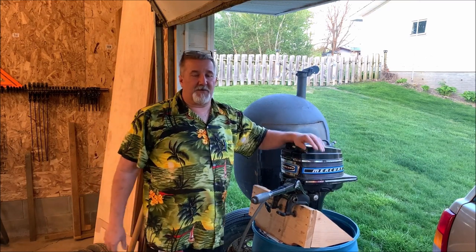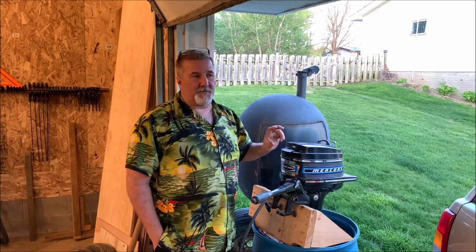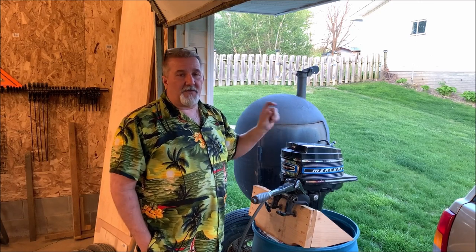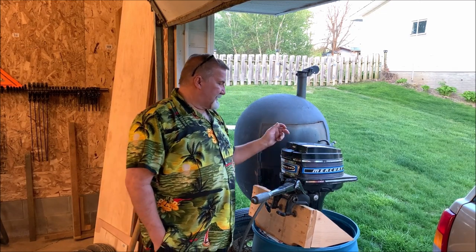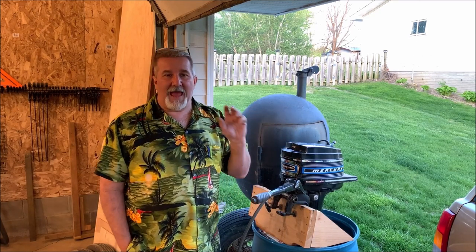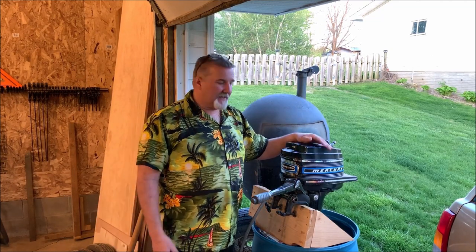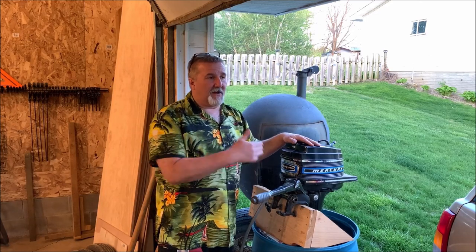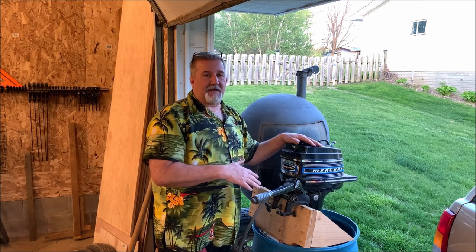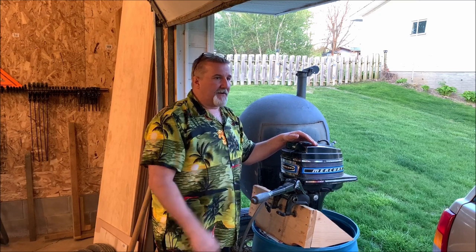It turns out the carburetor is really pretty clean overall. New gaskets in the carburetor for the intake and the float bowl and stuff like that. But the real trick was getting the fuel pump membrane back to new. It's limber. It moves like it's supposed to now. It consistently pumps gas. Actually, I came back out here, as you saw, and started it up about 45 minutes after it sat and it popped right off. And no primer bulb or nothing, just popped right off. So it's good.